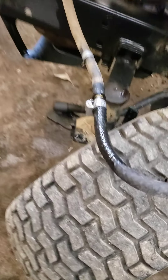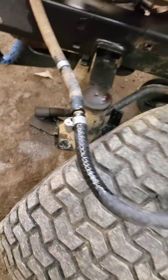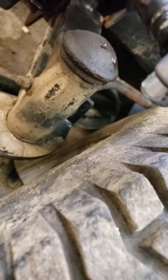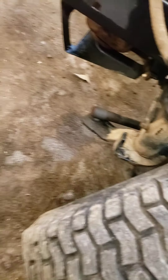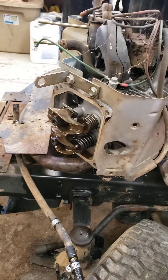I got carburetor gaskets coming. The fuel that keeps dripping out of it is cloudy — I'm about to pull the tank. I drained the tank, put some fresh fuel in it, and it's still cloudy looking. I don't know, it's nasty, it smells like hell. If you ever find a mower with a Kohler Courage in it, don't get it.